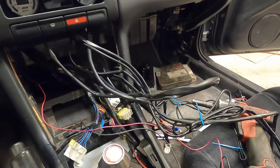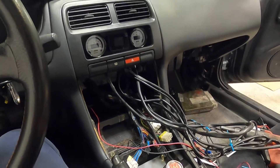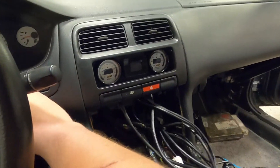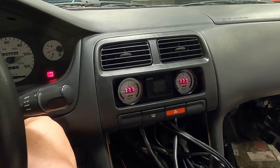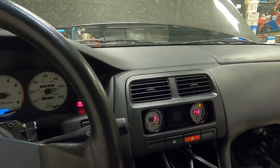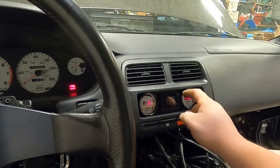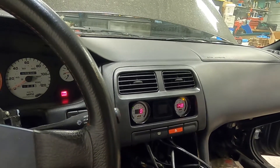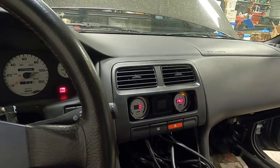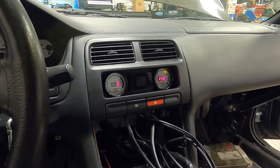A little while later — the wiring still looks like a mess but I got everything sorted out for the most part. There are still a few sensors I need to wire up and I need to finish tucking everything, but I'm still in the testing phase. When I turn this key I should get power to all three gauges. It looks like I've got power to my boost gauge and my air fuel gauge, but I'm not getting power to my oil and water temp gauge. I'll have to double check my wiring, but I'm pretty sure this gauge is burnt out. It's a Powered by Max gauge and I really did like it, but it would appear it's done for. I may have to contact them to get another gauge, but the setup honestly doesn't look too bad and it'll be fine like this for a while.